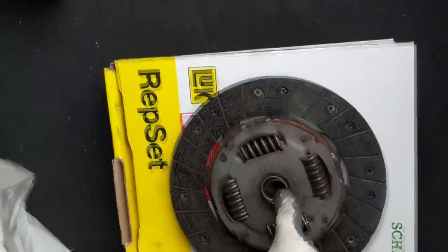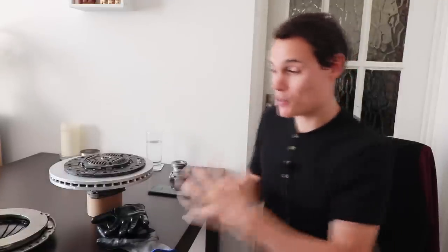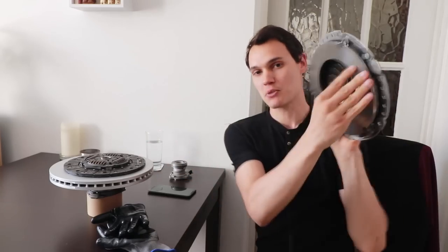Here's another video of my friction plate — you can hear a rattling sound from the spring-loaded mechanism that's been put under lots of strain and now has play in the spigot. That's from new drivers changing gear badly, dropping the clutch, selecting fourth gear instead of second, making the clutch struggle. The clutch I'm replacing is actually from my personal car — my fun car — and I reckon I've burnt the friction material on that one because the clutch pedal is quite high. Not all clutch pedals get higher as they wear, but this one does because this pressure plate isn't self-adjusting.